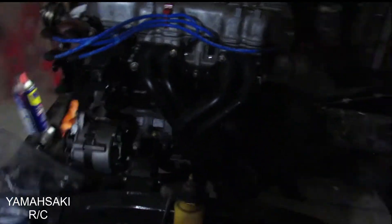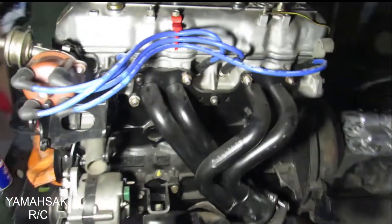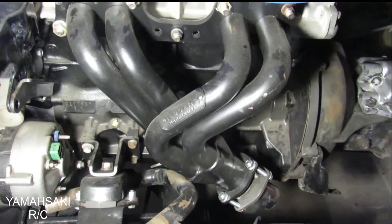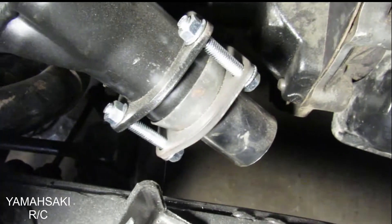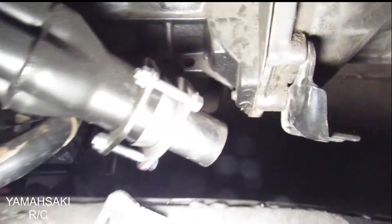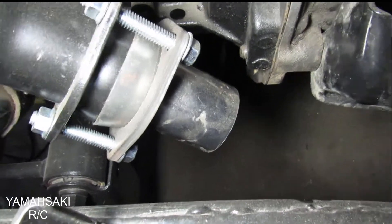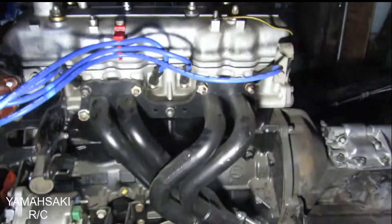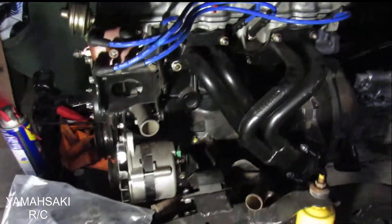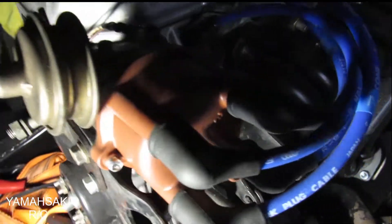Got the headers on — these headers are from Hedman, made in the USA, which is pretty cool. There's the headers looking nice and sharp. We have a little fitting down here; these flanges are what's holding that on, and the muffler shop is actually going to weld pipe to that part. Still have to torque the bolts but that's no biggie. Got the distributor on — that's pretty much the next part — new cap, new rotor, new plugs.